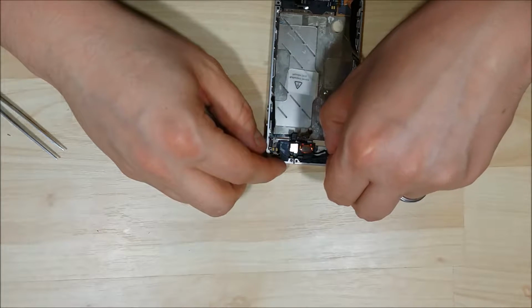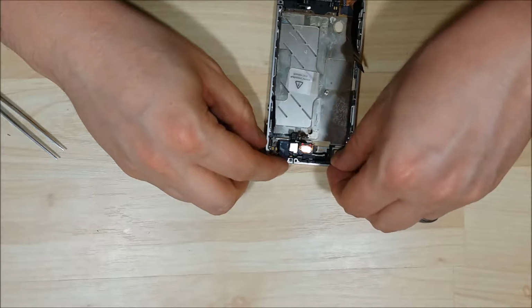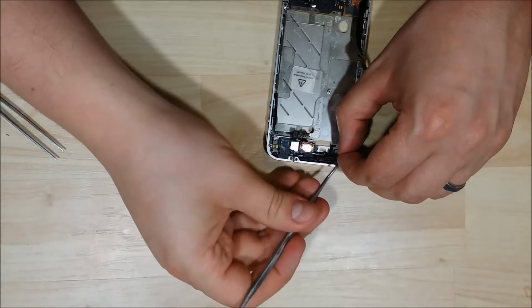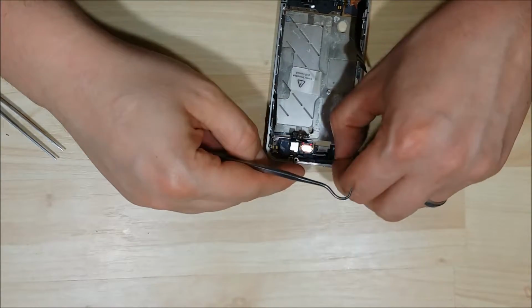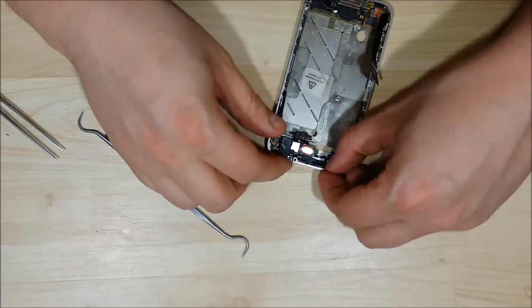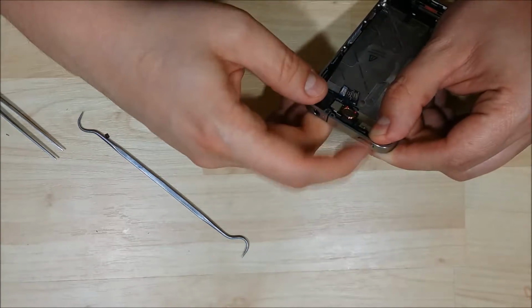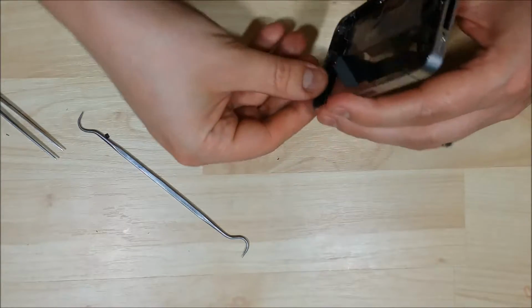And you're going to want to slide the housing for the power button. It goes in front of the black piece you just did. There's a little metal clip you can see that needs to go in front of. Make sure your power button is flush on the outside of the phone, and just press the plastic back into place, like so. Just test your power button, make sure that it is functioning. It is depressing. You can hear it kind of click.